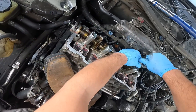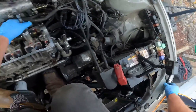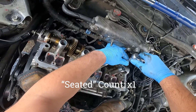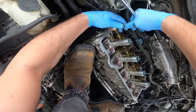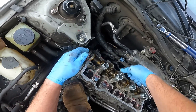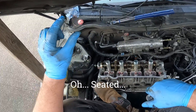Take our extension with the socket on it and run these down the rest of the way. Now that those valve lash adjusters are actually in there, I'm going to have to put a little tension on the cam in order to do this. The key here is going to be nice even pressure. We're just going to want to get these seated — work our way from the outside in. All these are seated — when I say seated, I mean just hold the wrench and go until it stops, exerting no force. Just go until it stops. It's seated — the metal is pressed together.